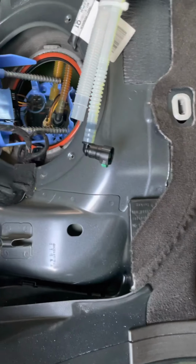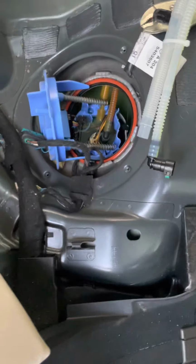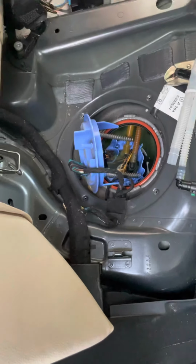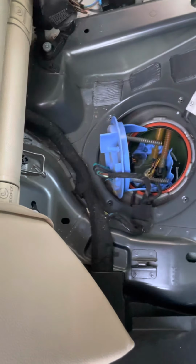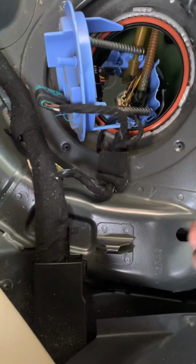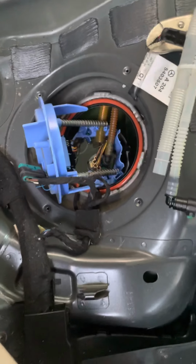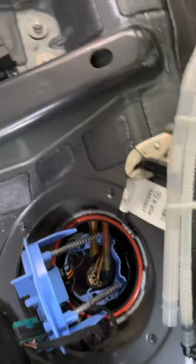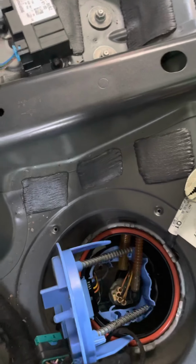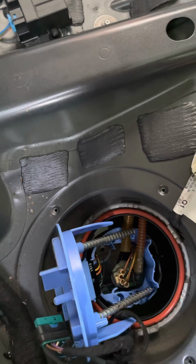All you do is get in front of the seat right here and just push back. When you push back, lift up a little. You'll feel when it gives. At that point, the seat just comes right up. You are able to do one side at a time. You don't have to do them both at the same time. Once it lifts up, leave it lifted up a little bit. Go to the other side, same thing. See, it comes right out. It's not difficult. It just seems like it doesn't want to come out. Just yank on it. It's fine, and you won't tear it up.